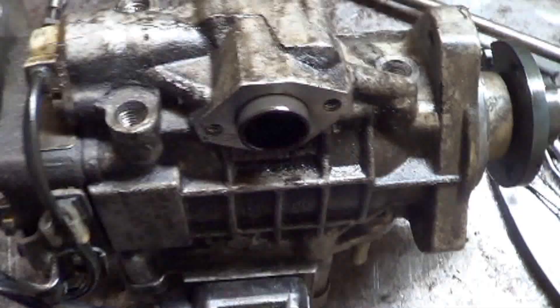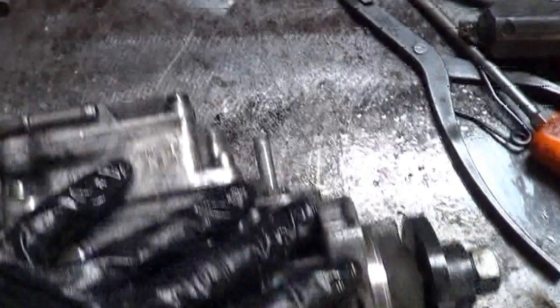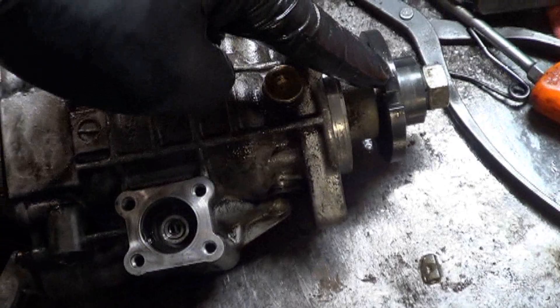What I can see is this piston is able to move — it's not jammed up, it's not cocked. It is able to move full travel down and all the way up. And I'm also able to see that it does affect the position of the hub. So that means it is probably affecting the timing.